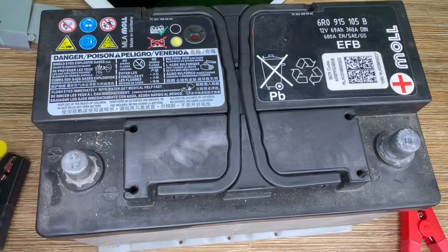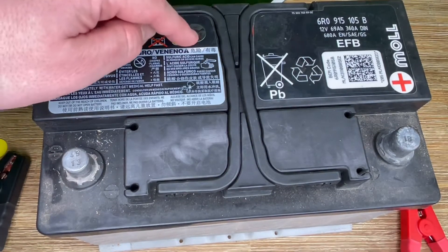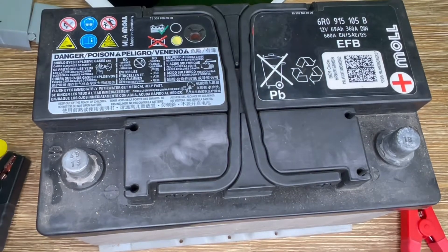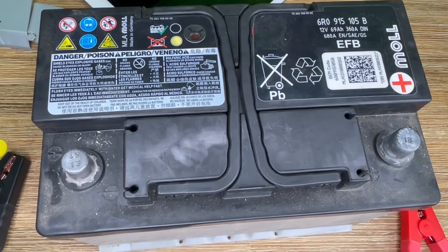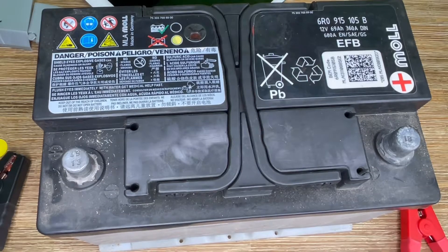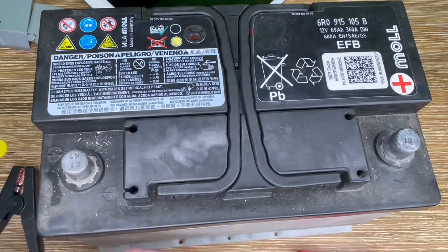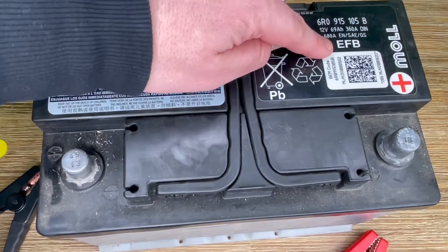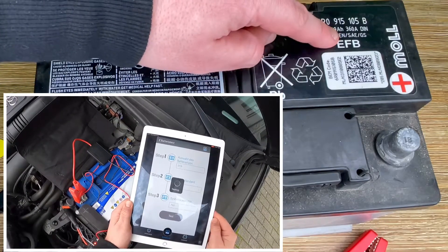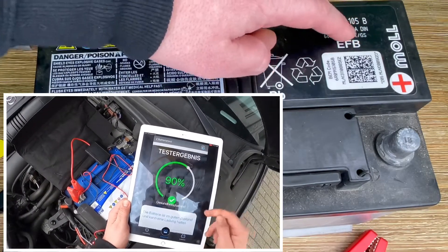It is really important to check it using an AGM or EFB battery tester. If the vehicle was originally supplied with an EFB battery, an EFB battery can also be used as a replacement. If the car owner requires greater performance or has a very demanding driving profile with a lot of urban traffic, a powerful AGM battery can be selected — but in that case you have to relearn the battery system using an OBD2 scanner, which tells the car that the battery is new.